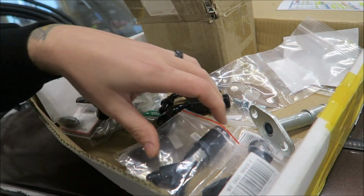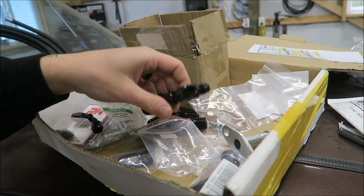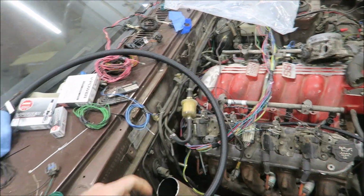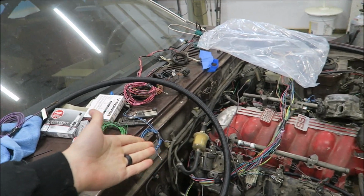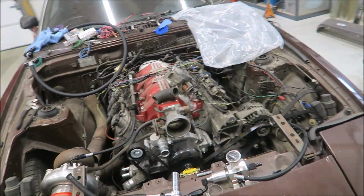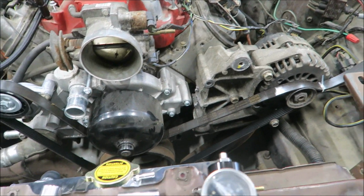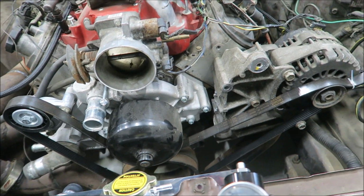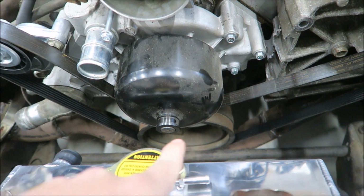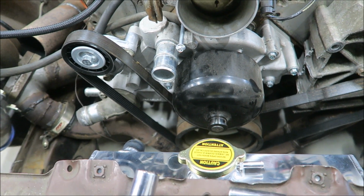Almost every fitting that I need for the fuel system. Almost. I got my Y the other day. The only thing I need now are some new fuel rails, and then I could run the line now, but I'll just wait until it's really urgent. I got the tensioner for the F-body pump, and I got a rough idea on how the belt is going to be routed, most likely. First impression is, yeah, there might not be enough on the crank. It's only grabbing a third of it, but people have run it and they were like, yeah, I didn't have any problems, so whatever.